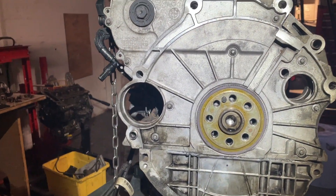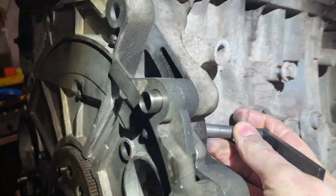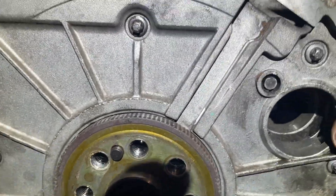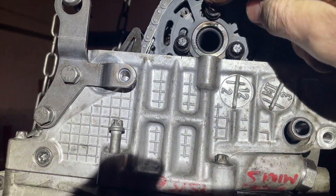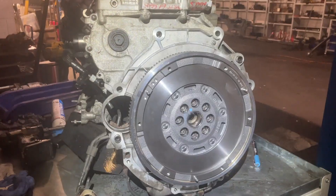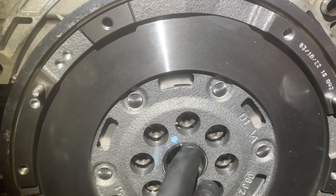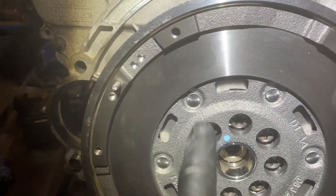When the flywheel is on, we need to pin the flywheel using this locator tool. It goes through there into the flywheel, and when it's in position and pinned we'll lock these down and the engine is timed. The new flywheel is on — compared to the last one there's obviously a lot less play. I put a dot on there because on the other side is the keyway, so it's easier to locate when fitting as it's very heavy.